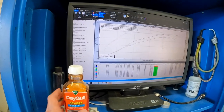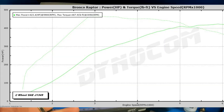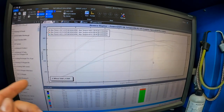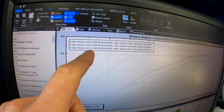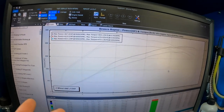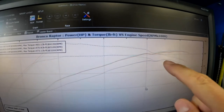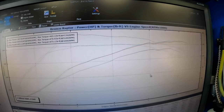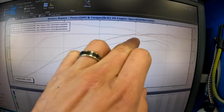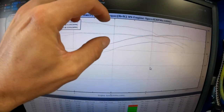You can tell it's pollen season here in South Carolina — yellow dust everywhere. We ran it with some Boostane and basically what we found is the tune is pretty much maxed out on 93. We picked up between 419.5 up to 423 horsepower with the Boostane, and picked up about another two or three pound-feet of torque. You can see that at the top of the graph, it's just carrying it out a little bit longer — basically running just a little bit more timing. But the story is really the difference between stock and the tuned version — that gap is enormous.